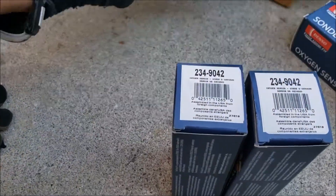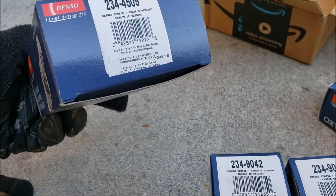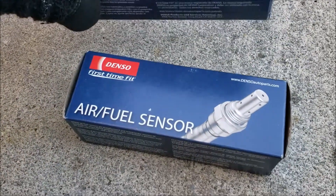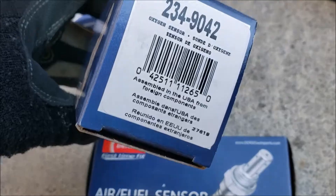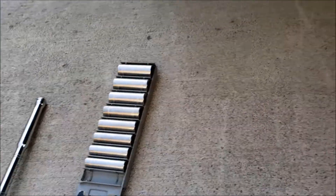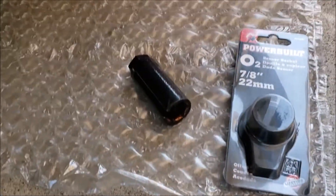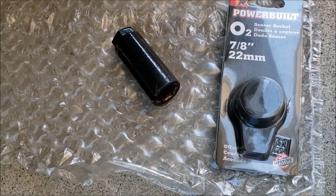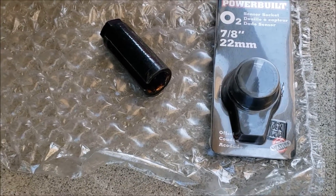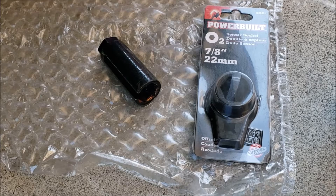Just to show you the parts I bought — Nippon Denso, which are factory OEM parts. You can buy them on Amazon or RockAuto. These are your air fuel sensors, and both of these are the same — they're the ones prior to the cat. For tools you'll need your standard metric socket set for this Japanese vehicle, probably several extensions. I've got two different types of O2 sensor sockets — sometimes one works better than the other, so I switch off. First thing I'm going to do is throw some penetrating fluid on there; I like LPS 2.